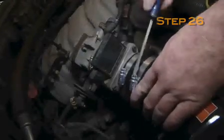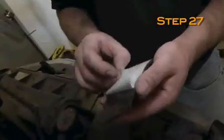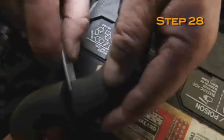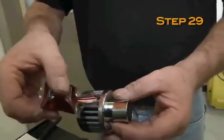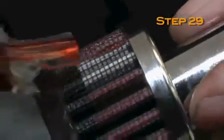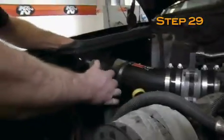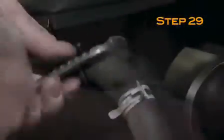Install the K&N intake tube into the silicone hose and tighten the hose clamp. Apply the gasket provided onto the heat shield to cover the exposed bolts. On models equipped with air injection, cut the air injection hose just past the first bend as shown. On models equipped with air injection, oil the air filter with the oil provided. Insert the air filter through the small hole in the heat shield. Attach the air injection hose to the air filter and secure with the OE hose clamp.